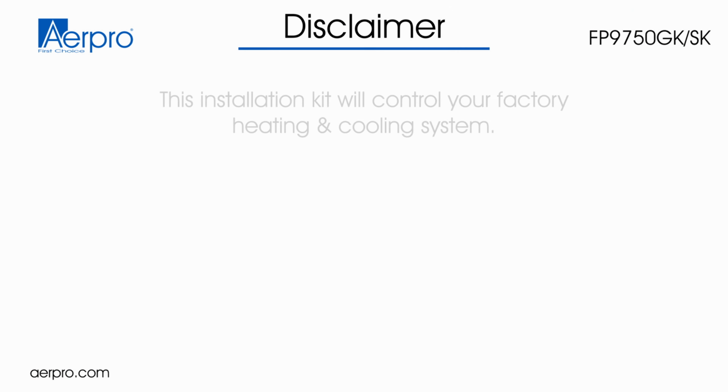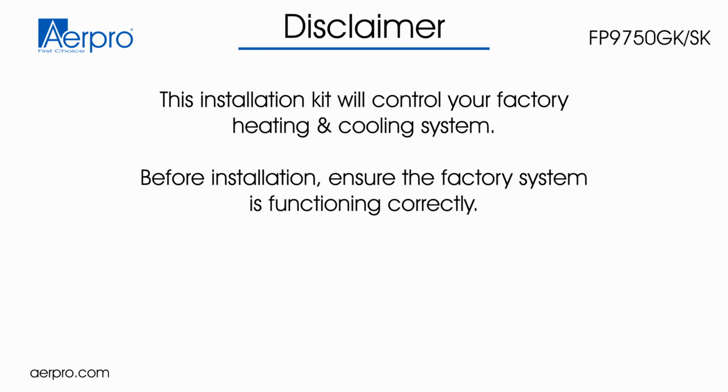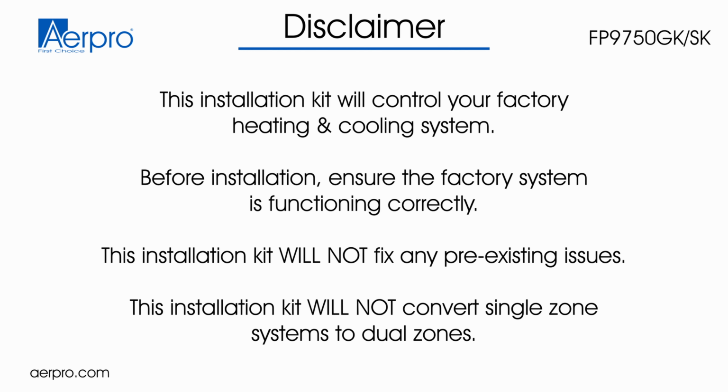Before we continue, the FP9750GK you are about to install will also control your factory heating and cooling system. To ensure correct functionality, please confirm the factory system is functioning correctly prior to installation. This controller will not fix any prior issues with the heating or cooling system unless the fault lies with the factory head unit. This kit will not convert a single zone vehicle to dual zone.